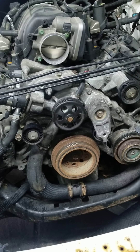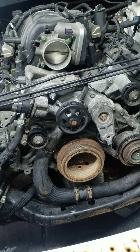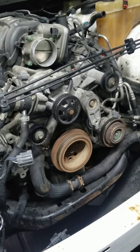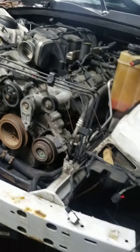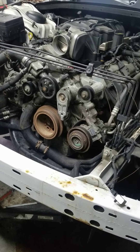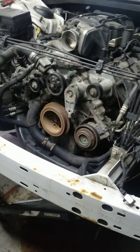I'm then going to start the engine and make sure it has oil pressure. If it does, we're going to let it run and see if the valve train quiets up quite a bit and totally down. If it does, then we have our point and cause for this engine being so noisy. Then from there, the owner and I are going to discuss how to move forward — whether he wants to replace the engine, or if we're just going to pull the heads, do cam, lifters, a new high-volume high-pressure oil pump, and timing chain and guides and put this engine back together.